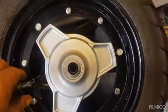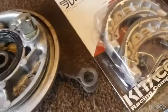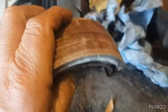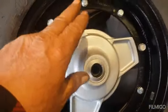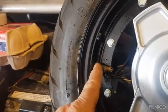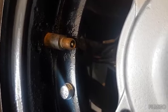Right then, wheel's back together and the tyre stayed up, so I'm happy about that. Need to find a new valve. Clean that up a bit, we'll drop some new brakes in it. Although these look alright, with age they come delaminated - it's just not worth taking the chance. We'll drop them in and drop the front wheel back in. Put all new fixings all the way around, smartened it up a bit. Where it was rotted here a little bit I've actually put a washer behind that, and that's bob on now - the bit of rot is covered with the washer.